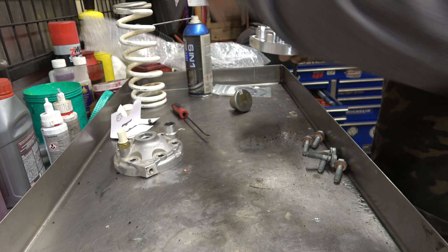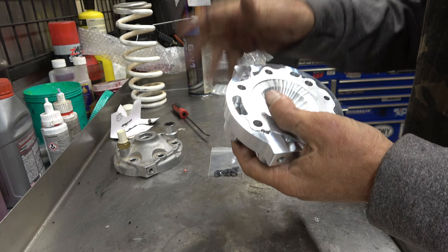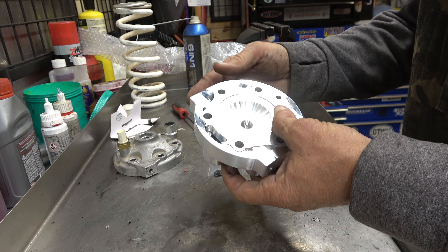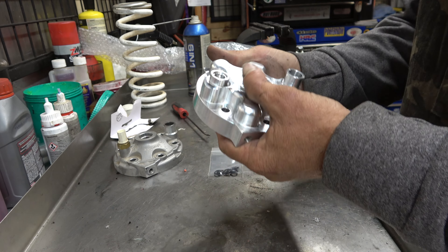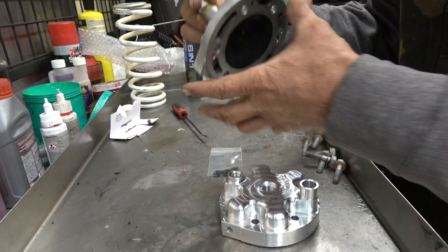There's a beautiful lovely piece of machined awesomeness from RK Tech - this is the high comp head. It's not the ultra high comp, just the high comp. That is good for 6,000 to 10,000 feet without having to do anything with the gas, just run normal gas. Obviously got our spot for the sensor, so we'll go ahead and pull this one out.